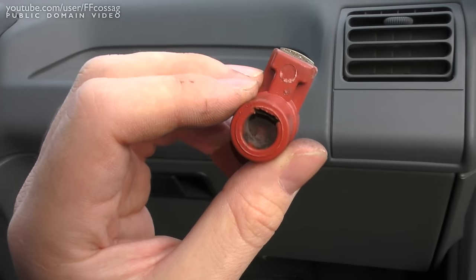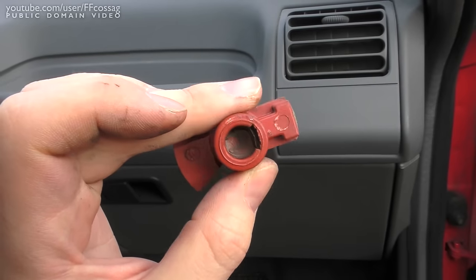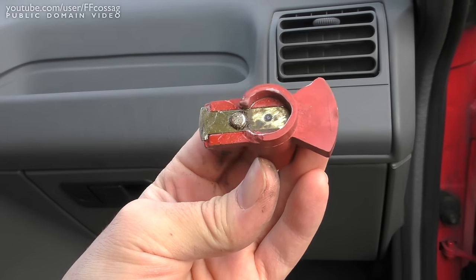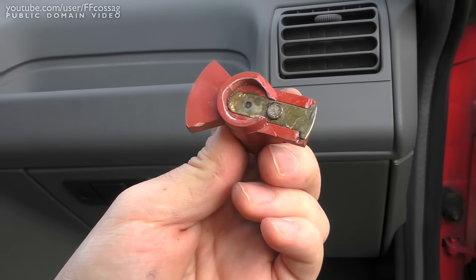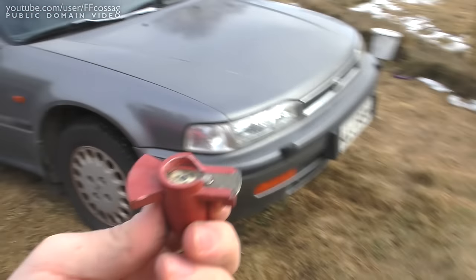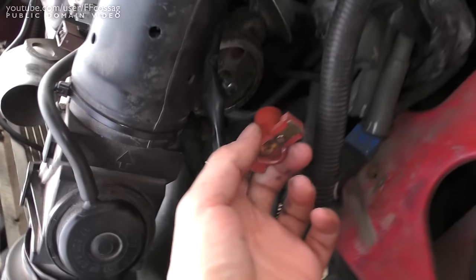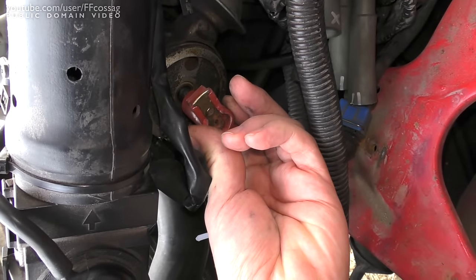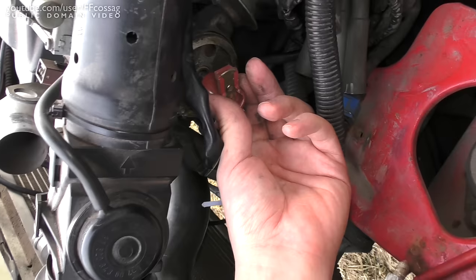There's actually supposed to be a little plastic piece in there which hooks into the cutout on the rotor of the actual engine part of the distributor. So this is a ruined plastic piece, and we're not going to be getting that back together very well at all. But I have cleaned it up, and if we go to the engine, it does mount relatively well. It's going to be a bit fluid and will have a tendency to move around and drift over time, but it's not entirely loose, so I'm figuring I'll just try and shove that on there and we'll see what happens.